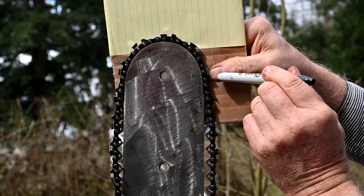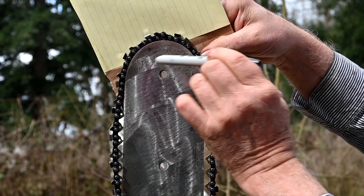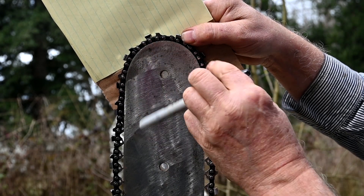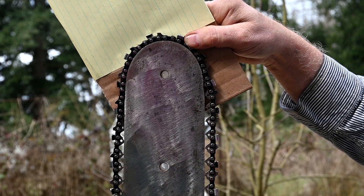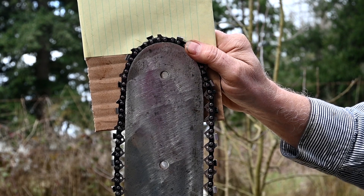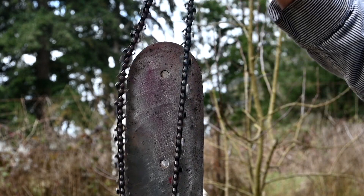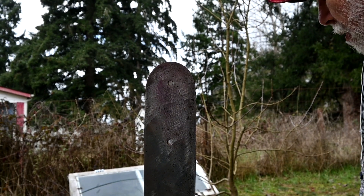Right in behind the tooth here there's a small tooth, and as it gets around it sticks out more and more to keep the cutter from actually hitting the wood. The only thing that's weird about this one is it's stacked in between another plate, so it's actually fairly wide. It takes more horsepower to run these just because the raker has a double width instead of single like on a regular chain. That's a good overview of the chains. Now we'll talk about safety bars.